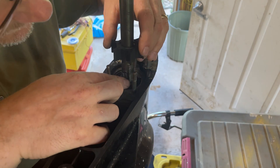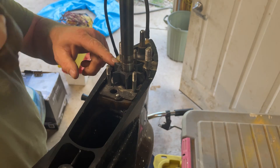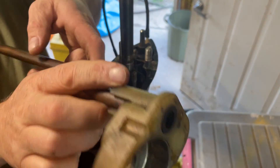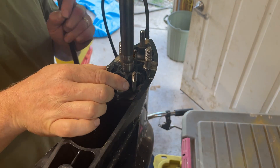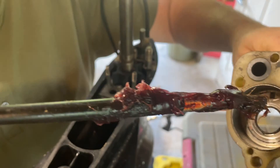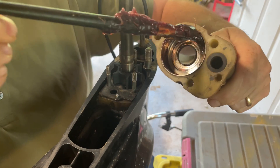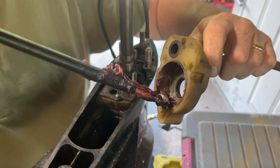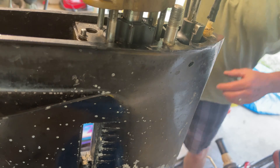We're going to slide this puppy down and then line that up. I'm going to hold that with my finger. You've got to get into here but it's too tight because it seals really, really tight in there. Basically these rubber fins are going to bend when they're in there. The easiest way to do that is just put on a little bit of grease — probably putting on too much but it'll come out after. Now we're just going to drop this on here. I'll grease up these impeller tips a little bit.